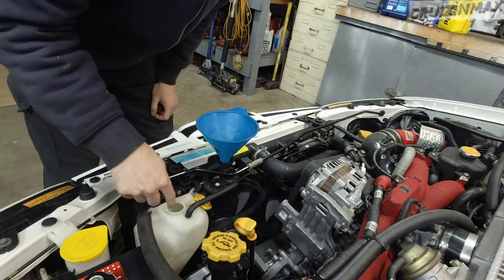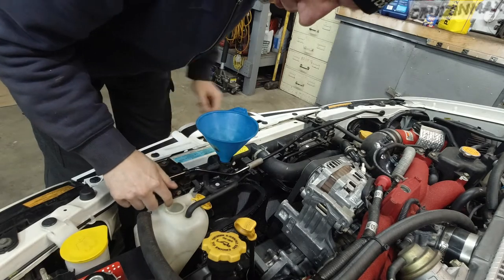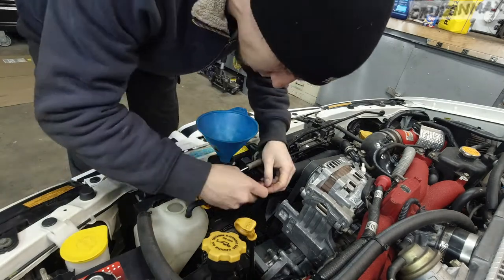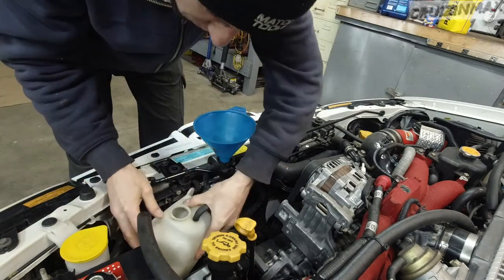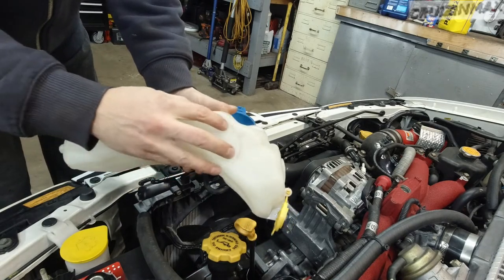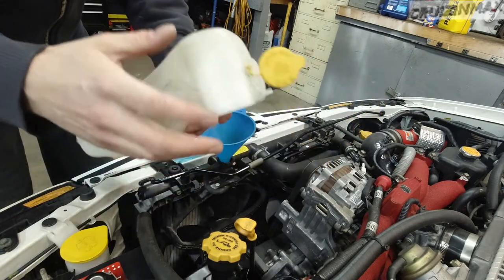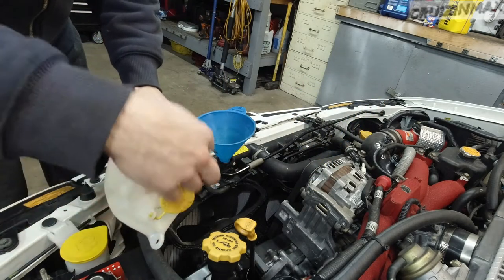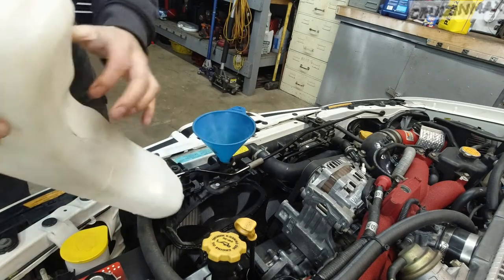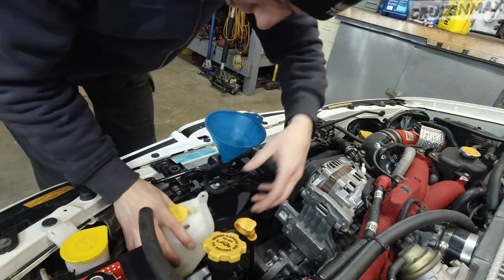I do have some - well, not old but green coolant in the reservoir tank; I should probably drain that out. Just clean this up - there was actually quite a lot of dirt all here on this wall, on the inside and on the bottom. Looks much better. Sprayed brake cleaner all around a few times, shook it a few times, then filled it with water a few times and it's like new.